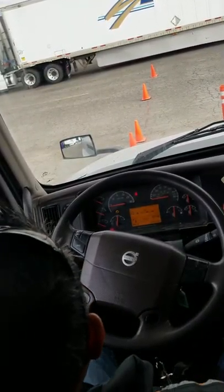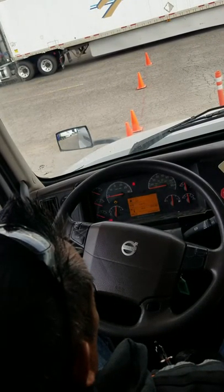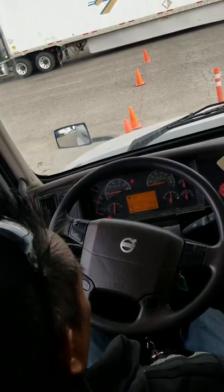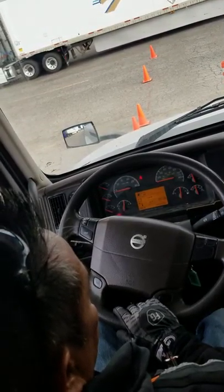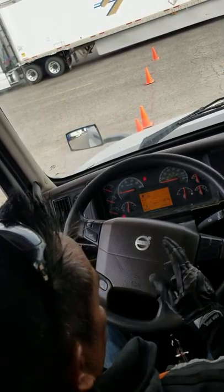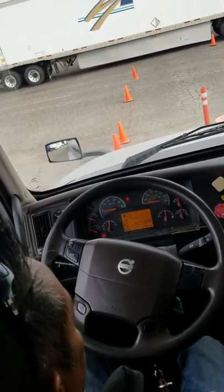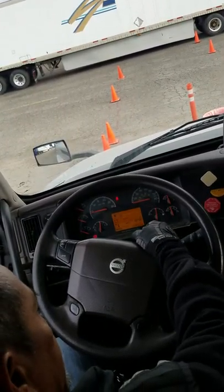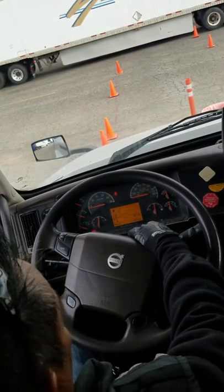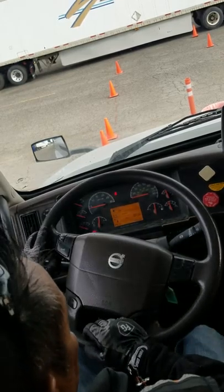That is my static pressure. Right, now I'm going to apply my service brake and hold it firmly. It's going to settle again and announce that first reading. All right, Mr. Examiner, my primary needle settled at 90 PSI. Can you please time me for 60 seconds starting now? Meantime, you're keeping an eye on that needle, okay? The examiner's going to go, all right, Alex, your time's up. All right, 60 seconds up.